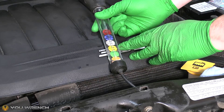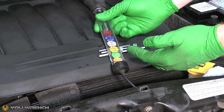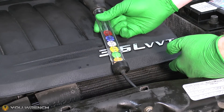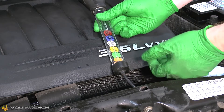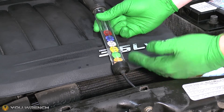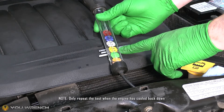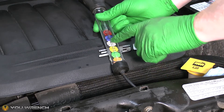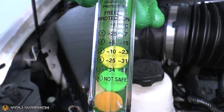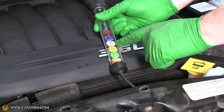If you found, like we did, that you're actually quite close to where you need to be, what you can do is top up your system — ideally using a concentrate rather than a pre-mixed coolant. Top up your coolant reservoir to the maximum level with that concentrate, then put the heater in your cabin to its full maximum temperature, let the engine run up to full operating temperature, and leave it there for about 10 minutes to make sure the coolant cycles. Repeat this test and hopefully that will get you up to where you need to be. On the opposite end of the scale, if you get all six discs floating, that means the coolant is not safe and you would absolutely want to get your coolant changed and reset to the proper level.